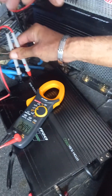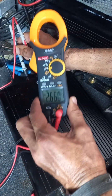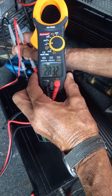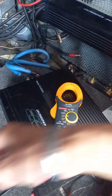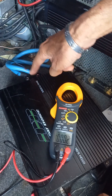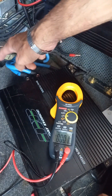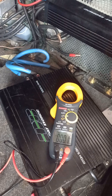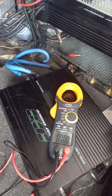Negative, positive on the amplifier — you're getting two-point-something volts. So that can be something wrong inside here sending that protect signal down the switch wire — that's the only thing connected. Should I disconnect the switch wire from this amp? Why not — I'll just stop the video.